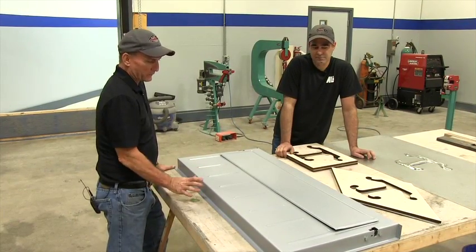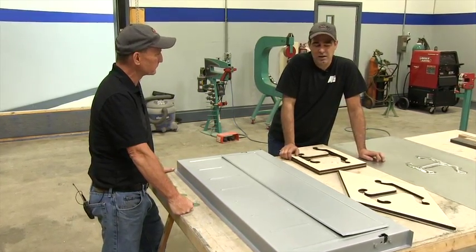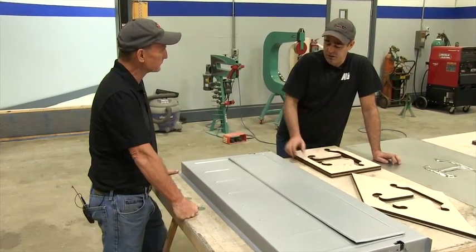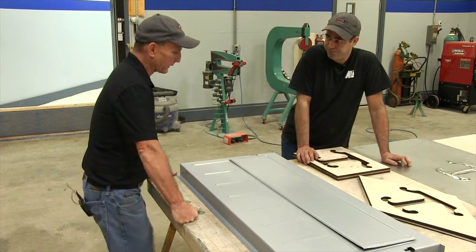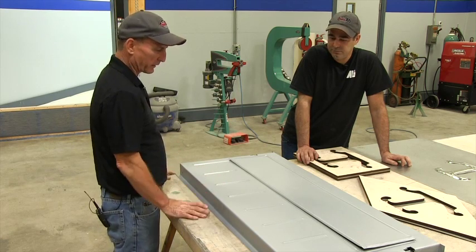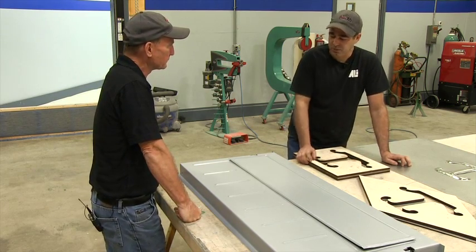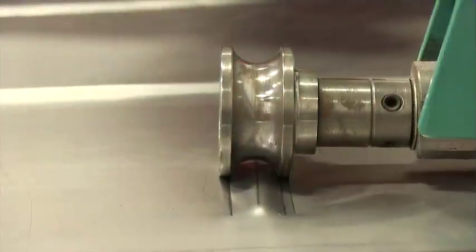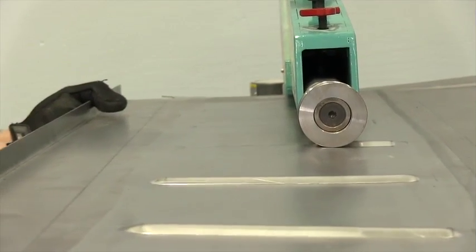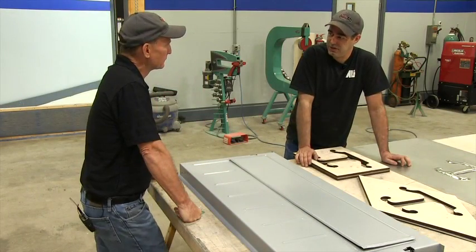Okay Michael, tell me a little bit about the tailgate. Well, I took all the measurements off the back of the bed to figure out the size, height, width, and all that, and then I went over to a piece of sheet metal and laid out all my lines — the bend lines, all the bead rolls — before I cut anything out. Those beads actually add a little bit of strength and structure to it as well as cosmetics. With the bead rolls you have to keep in mind that when you run it in the machine you need to run it up against the guide so you can keep the line straight, and they also have to be done before the bends are done. If you do the bends first, then you can't load it in the machine to do the beads.